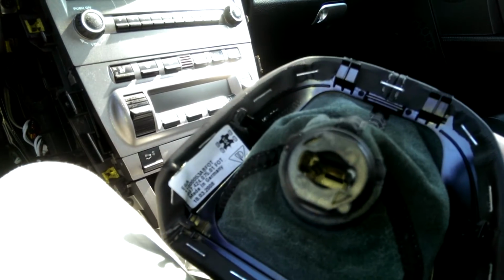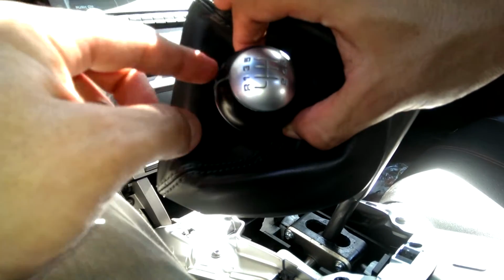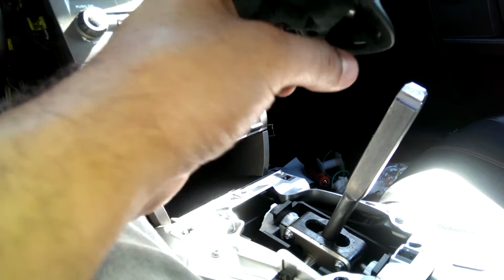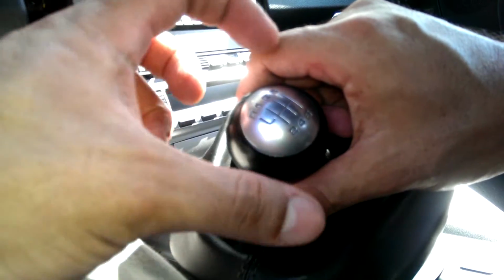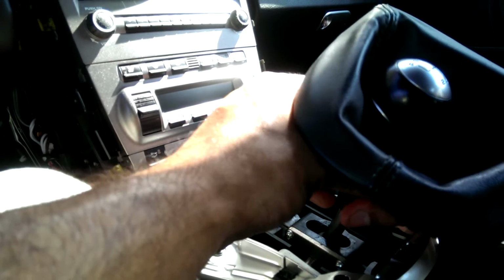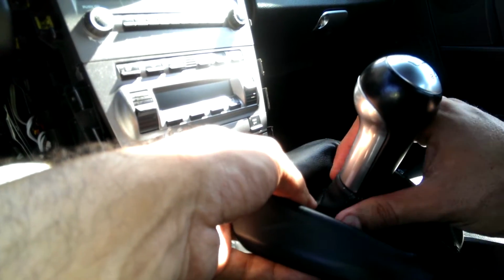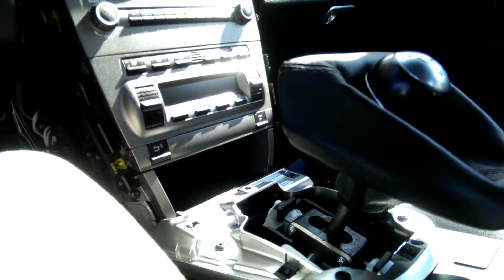At this point, to get the straight shot of the mechanism, for me, that meant turning from this position where it's lined up with the frame in first gear, turn the knob clockwise, from when you're staring at it from up above. Your mechanism is unlocked, slide down all the way, give it a good press, and now since we turned clockwise, you gotta go counterclockwise. I have a feeling the 911s, different model years, might have a different mechanism, because the Porsche manual says the exact opposite. Anyway, don't clip it in, just once it's lined up, let's get the black trim on.